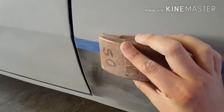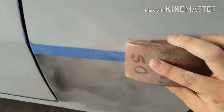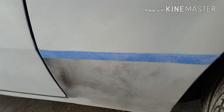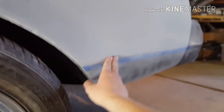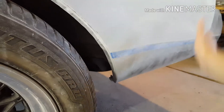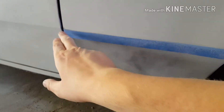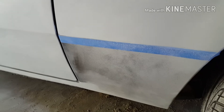Now while you're sanding you want to go away from the line - you don't want to sand down to it. Set your block down and sand up, away from the line. I don't want to do too much here since I already did that side. When you sand away from the line and get this whole area sanded out, this line will be nice and sharp. Then do the rest of the panel, and same on the back - sand away from the line, always away. Then you leave this tape and tape right on this line on the top, then peel the bottom tape off.